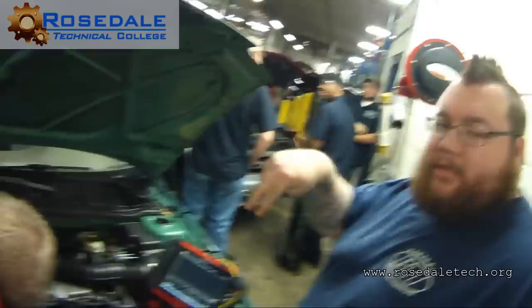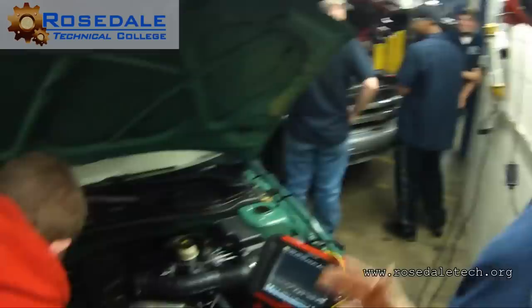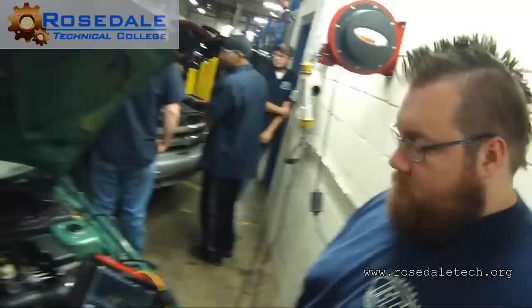What we're trying to figure out is... Okay, you just took that off. It's a couple options. We could have a loose female to male pin contact, where the female pin spread apart because someone was in there testing it. Or we have a wire problem right there, or we have a sensor problem. That's what we're trying to figure out. So play around with it a little bit. Let me get those guys set up. Tell me what you guys think.